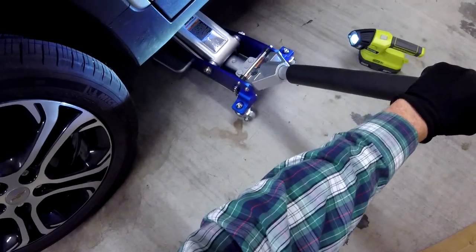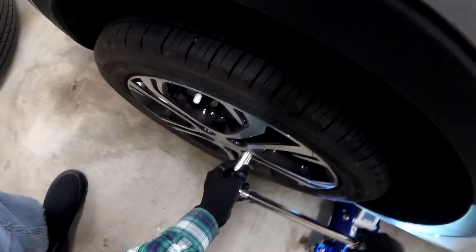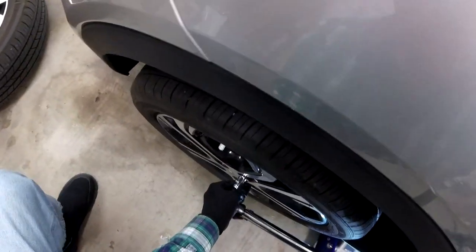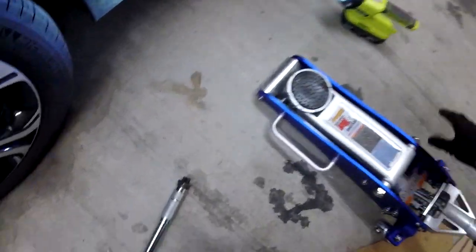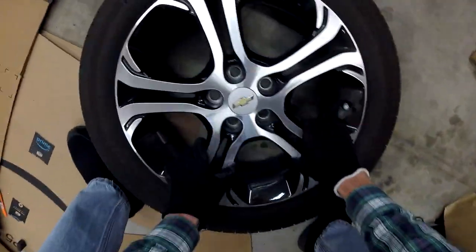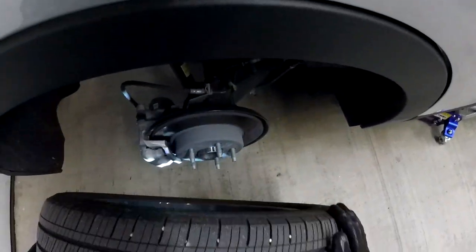In case you're not familiar with floor jacks: turning the handle to the left reduces the pressure and lowers the jack, and rotating the handle to the right closes the valve so you can pump it back up again. These are low-cost floor jacks and are missing certain features of more expensive ones. More expensive models can lift more tonnage, have a greater arm throw to lift higher, and some have locking pins you can use as a safety feature in place of jack stands.